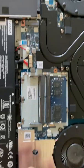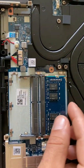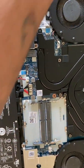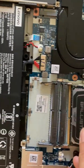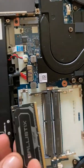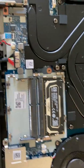Since I have my computer taken apart, I'm using my phone to do this. You see these little clips on the side? Just pull them out — and it's as simple as that. You slide that right out. Now what we're going to want to do — I went with Crucial Ballistix just for the price and quality. At a 45-degree angle, slide this in. Make sure you have everything lined up right, slide it in, and then push it down to where the clips clip over. Make sure it's in on both sides.